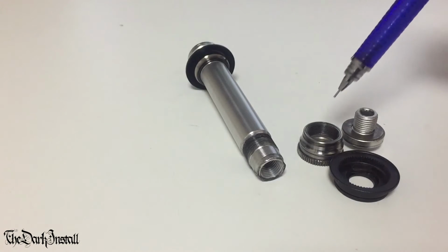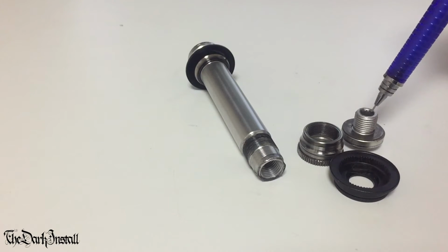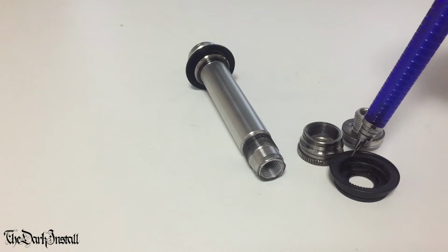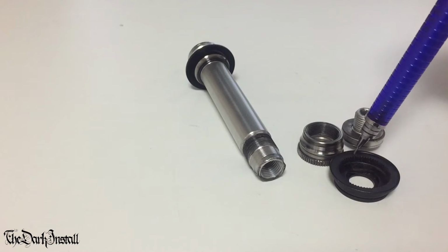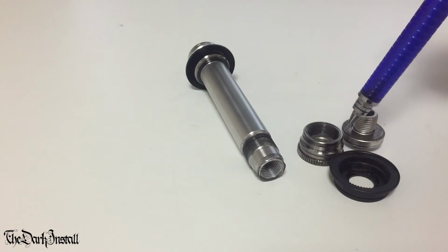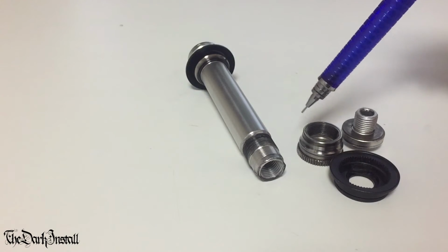Opening the axle up, then you can see this is the preload lockdown system. This is the outer locking system with a washer on it. Here you can see the spline that's cut into this plastic compression unit, which acts as a seal and also a locking part of the locking system. Here's the thread which the preload goes onto.